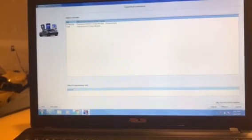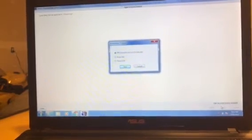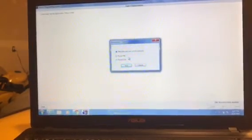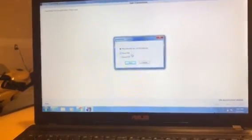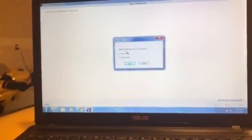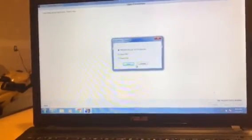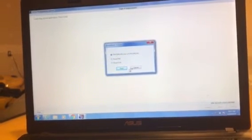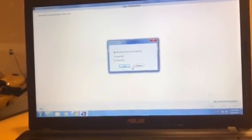I just want to give you an idea of what it looks like. I'm not going to complete the whole procedure since I've already done it and the car is running while I wait for a replacement ECM, which is on national backorder. Basically, SPS launches a special application and you click PIM — either 'PIM GM LAN link to ECM GM LAN,' 'reset PIM,' or 'reset ECM' depending on your situation. Since we're relinking the PIM back to the ECM, you click Next. It asked whether it was a new replacement PCM — had about three different options — and once I selected the appropriate one, it was that quick and I was able to restart the car.